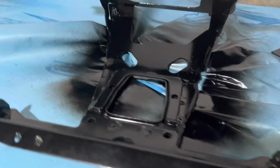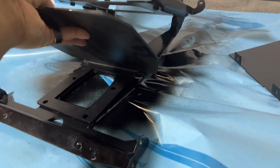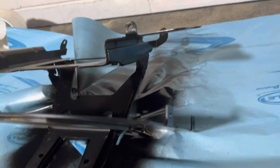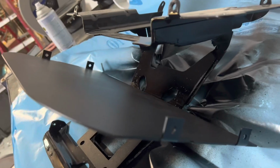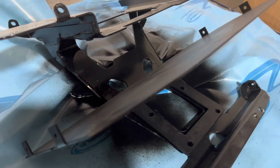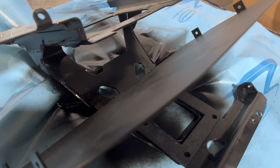Okay, now that our rack is nice and dry, so our electric rack's been modified. That drops into place right there. And then the extended amp plate drops right in, right on top of it, like that. Now look how much room you've created. Only negative drawback is you have to remove the vents. It's the only way to create this much room.